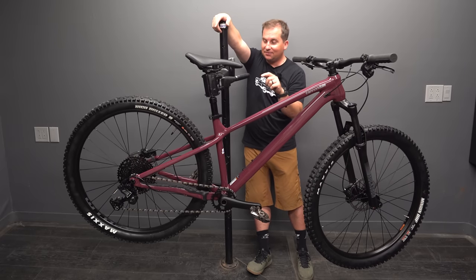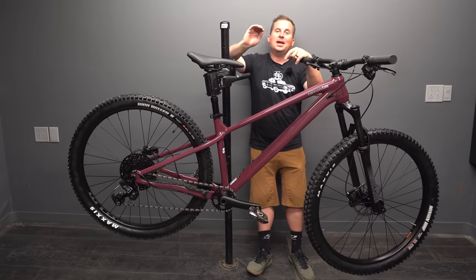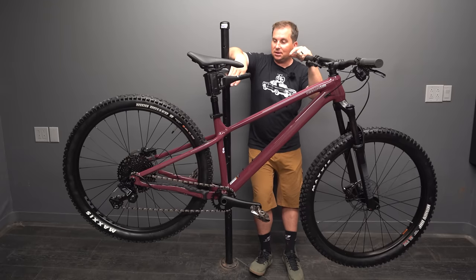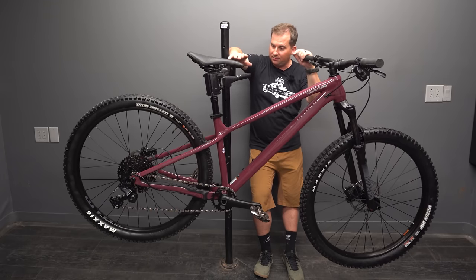We have Microshift Advent X 1x10 drivetrain, fantastic drivetrain. That is an excellent place to save money to make bikes more affordable. I'm running this on some of my $5,000 bikes. I just love this drivetrain. It's worked out really well for me.